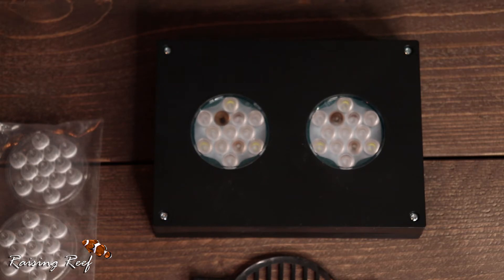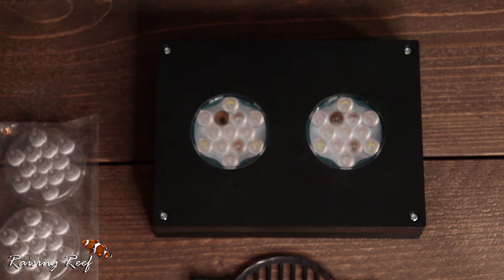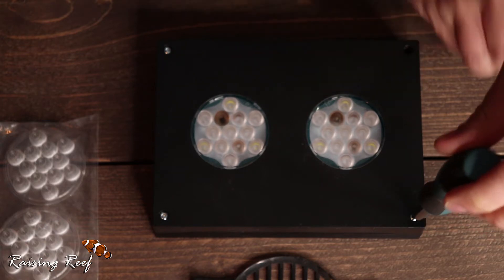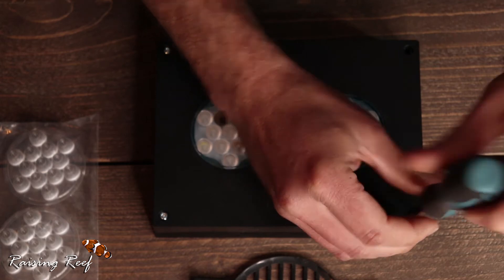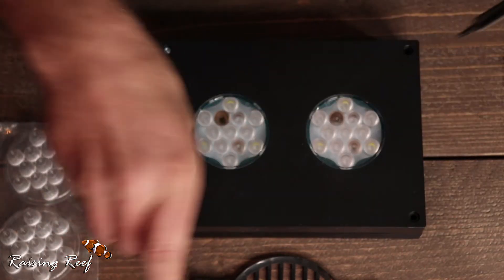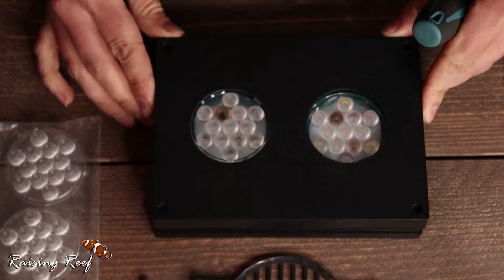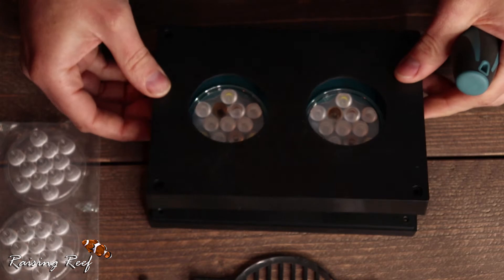So we're going to swap those over and as far as I'm aware it's as simple as just undoing these four screws, taking the top off - these probably just seat in position - and then I can screw it back on again, but we'll see how that goes. These little fixings are star bits by the looks of it, and looking at them just by eye they look like that one's probably the right size. So it's a T15 size star bit and that should just unscrew.